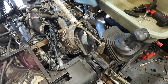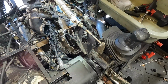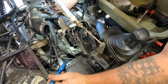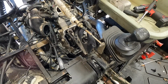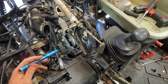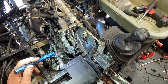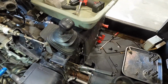All right, there's that. And there's that. Actually, I don't know if I set this back to TDC on the front cylinder yet. Looks like it, let me check. Nope, absolutely not. So I'm gonna pull these back out. Definitely gonna get a bunch of stored codes for this one, but it is what it is. So let's go ahead. I'm gonna bump this over. I'm gonna watch. There's the intake, or exhaust, I mean, overlap. Okay. Now I need to cut, whoop.